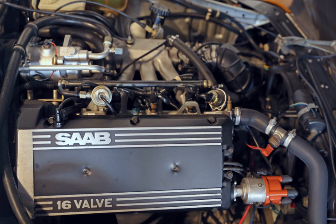The later motors had a revised oil sump system, head, timing cover, and different bell housing pattern. Unlike the previous B202, the block was no longer angled but straight, something that made it unsuitable for the 900 model with its gearbox under the engine, built into the engine oil sump. The longer stroke B234 was last produced in 1998, the last year for the 9000 model. The B234 was selected as one of Ward's 10 best engines for 1995 and 1996.